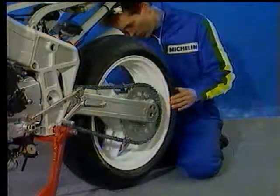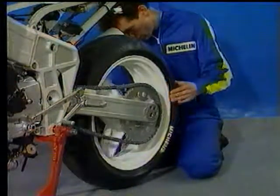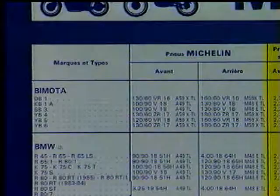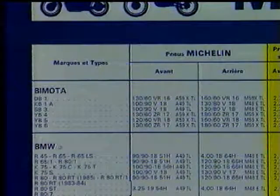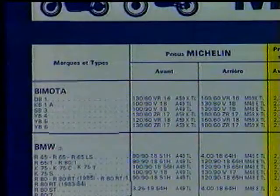We arrive at the rear wheel. As with the front wheel, check that the rear wheel has neither lateral nor radial runout to eliminate this as a possible cause of weave. The rear tire requires the same checks as the front tire.